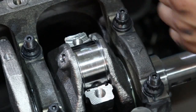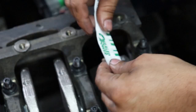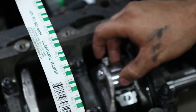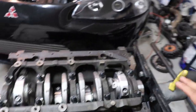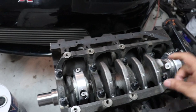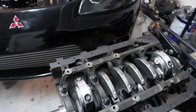We match up the thickness on the plastigauge chart and that determines the correct clearance. By looking at it we're just under about 3 thousandths of an inch, which is perfectly within spec for rod bearing clearances. What we did with the first cylinder we'll do with two, three, and four. I worked on the rotating assembly last night until 1:30 in the morning — all caps installed, all rods and pistons in, everything miked and plastigauged. Everything is well within spec. We've got about 6 thousandths of thrust clearance, which is a little much but perfectly fine since we don't plan on getting 100,000 miles out of this motor.